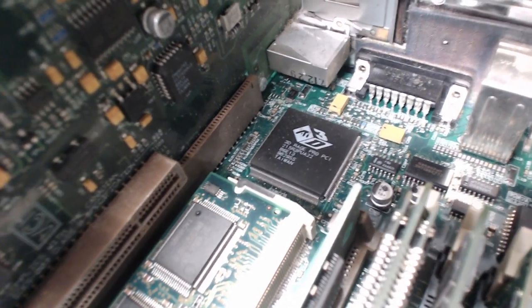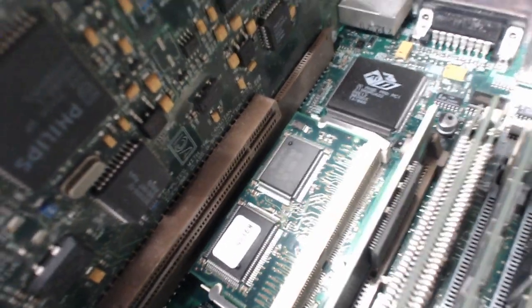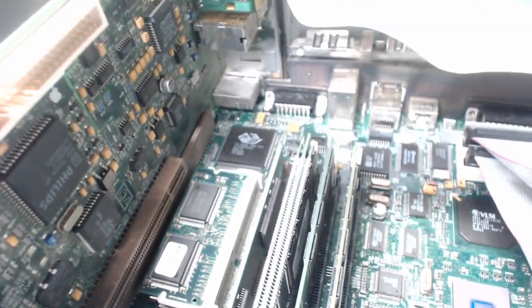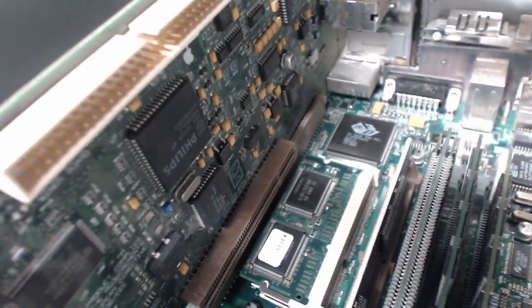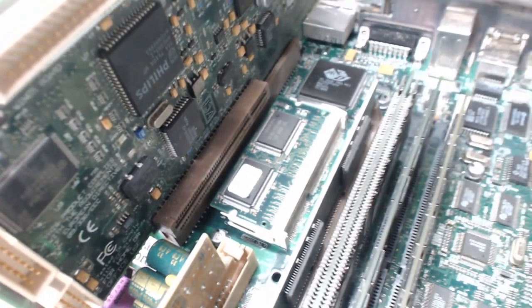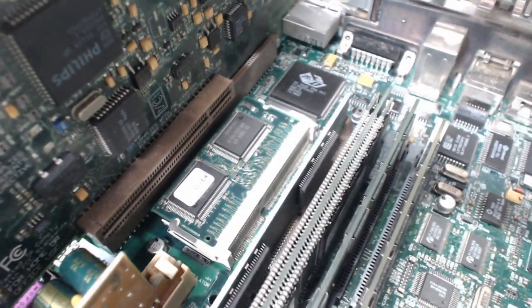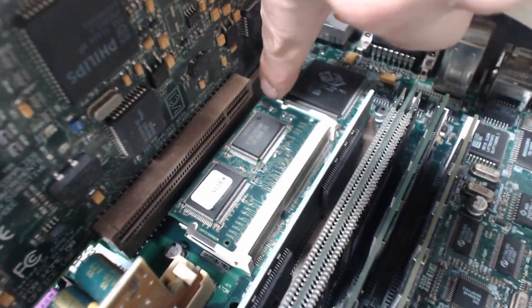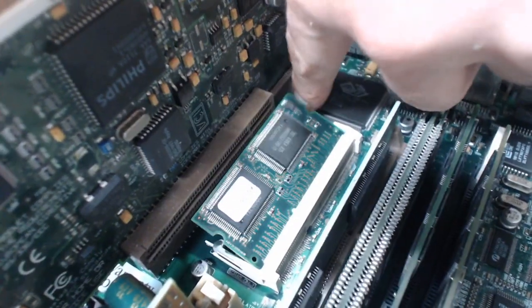So now you'll see next to the chipset, there's actually a VRAM slot, and that is occupied, although that was not occupied there by default, I don't believe. So actually, maybe I'm talking out of my butt. Hold on a second. Because I think I put a new one in there, or maybe I was going to, and I did not. Let me see if the sticker matches the... Because I have a bunch of memory modules here, and they're all the same. Yep, no, I think that's the original one in there. So we're going to swap that out. Right now, it says it has 6 megabytes of video memory. I believe what that means is this can take 2 megabytes on board and 4 megabytes in this upgrade. Now, I think the chips I have are actually 8 megabytes, so we're going to do a little brief surgery here and just see if we can upgrade that any further.